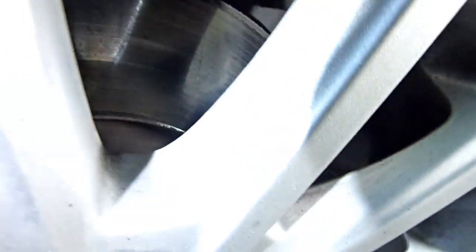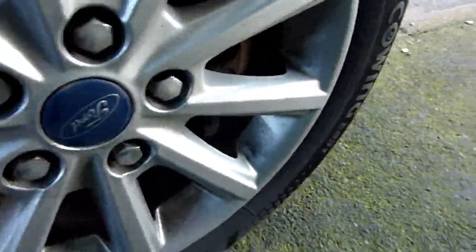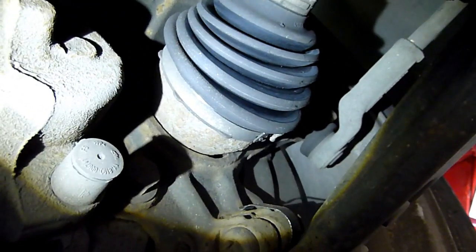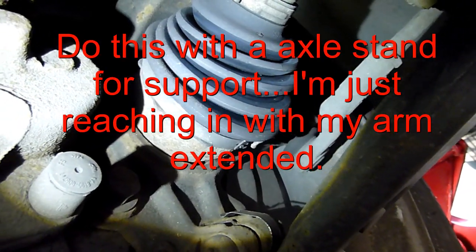Check the brakes on one side — that should be okay. Look in there with some light and check the brake pad for wear. I've got half an inch of brake pad, that's quite a lot — at least maybe 1-something centimetres. Check the bearings, and also check the ball joint and the rubber booting on there.